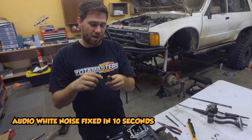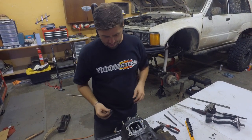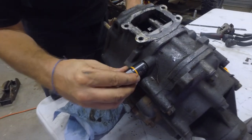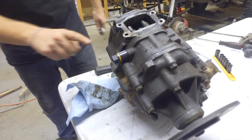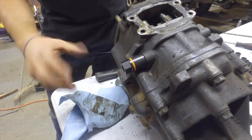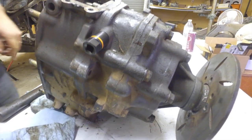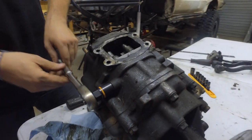There's a slight tapered entry on the front of this, which helps it slide in and onto damaged bolts. We're just going to slide this over the edge and get it all centered up as best we can. It's got a hex on the outside so you can put a wrench over the end of it, and it also has a 3/8ths drive, so I'm going to use the 3/8ths drive to make sure we're going the right way.